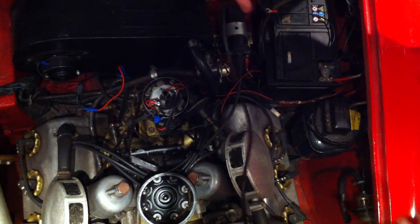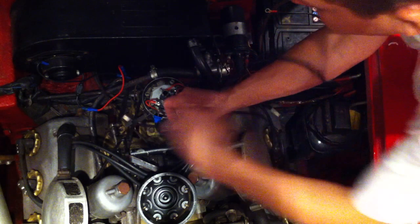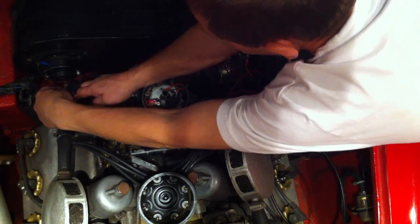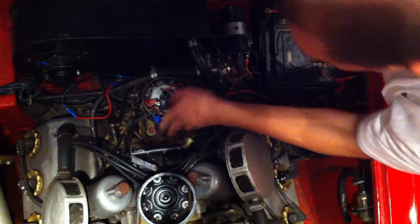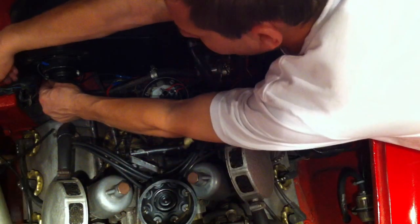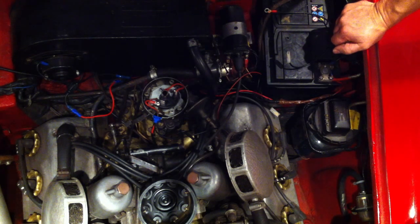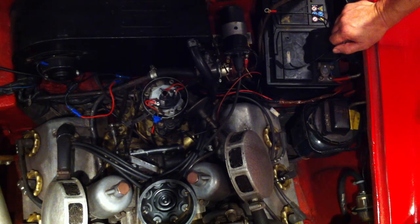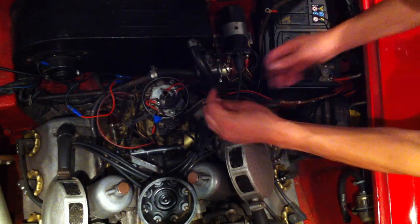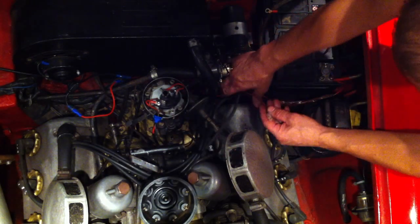This really long black wire — we connect this to the fuse box, which will give you your negative feed. I like to pass it underneath these water pipes and the little bar underneath there by the heat subcontroller. Obviously if you've got a Daimler V8, it's going to be slightly different how you wire it up. But basically this wire runs through here alongside the original wiring loom, right round to your fuse box, picking up from your negative feed — so when you turn the ignition on, that becomes your negative feed. Then you're left with the red and black one — this is your trigger for your coil, which was originally the one for the set of points. Run that through and tape it up underneath so it all looks nice and neat.